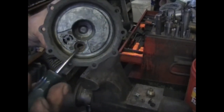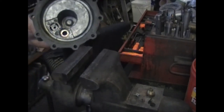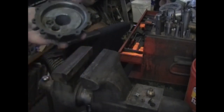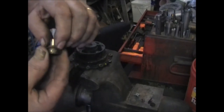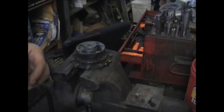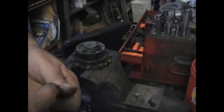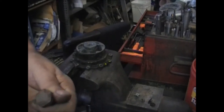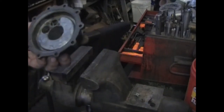There's the seat area for one of the valves right here, and this is where the spring sits, then the valve sits on top of it, and then that brass cover sits on top of that. We want to remove the washer that goes underneath — this is a paper washer and you need to get a new one. Sometimes on these fancy Packards this nut is chrome plated. I'll wash it just to make sure. Now gather up all the parts and we'll put it back together after it's all cleaned up. Stay tuned.